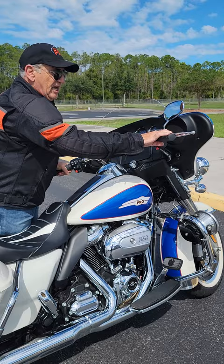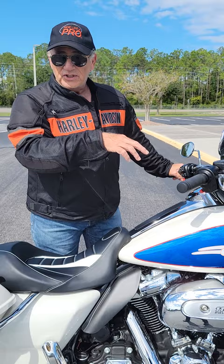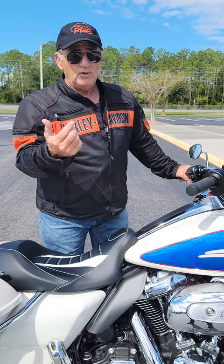So it takes a little bit of pressure to keep that from happening, and it scares a lot of people because they don't want to ride when the bike is at full lock. So here's a really easy tip: the factory recommends 36 pounds of air pressure in the front tire and 40 in the rear — just put 40 in the front as well. I leave my bike at 40 front and rear all the time, and you'll never get that sensation of it wanting to pull to full lock.